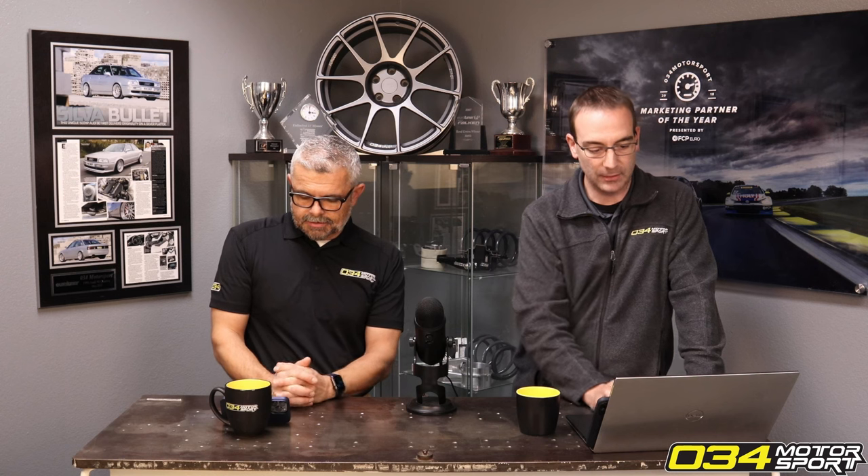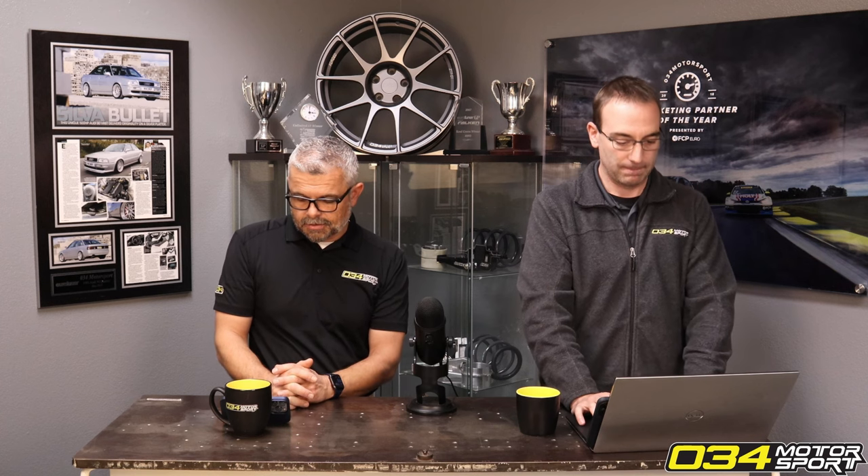To put it in perspective, the VLN TTRS had small — I think honestly they were GTE rear rotors. They were solid, like tiny tiny little rotors in the back. So usually rear braking isn't the problem with these. I think what you said is on the right track — if they are getting warped, it's probably because you're engaging traction control, stability control, and that is very hard on the brakes.